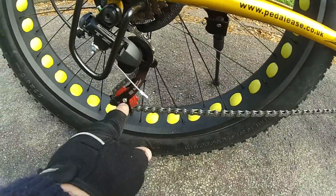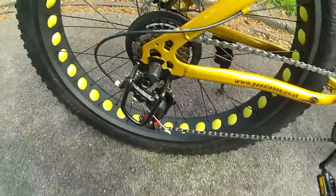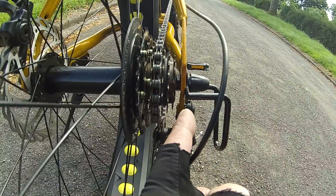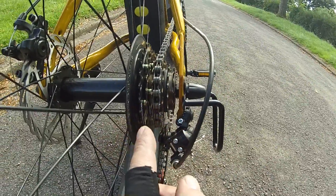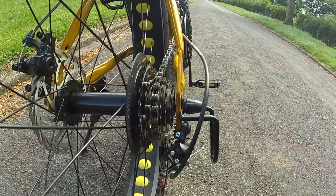The second thing was, this was touching the spokes. And when I looked closer, the frame coming down here was bent in, so this was even touching first gear. So I had to take the back wheel off, take the gears off, straighten that out, and put it back on.